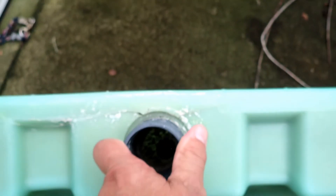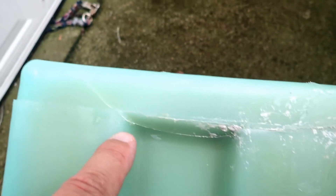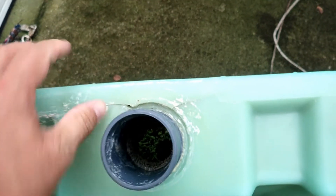Here's the offending blackwater holding tank that came out of the owner's side of the boat — it's got a trapezoid shape. When we discovered the obvious — the smell and the presence of fluid on the shelf underneath this tank running down into the bilge — we knew something was wrong. We didn't know if it was a hose or what until we disassembled it. The tank is actually cracked all the way across and up, so it wasn't holding anything; the sewage was going straight through.